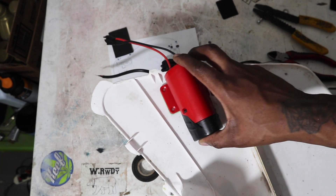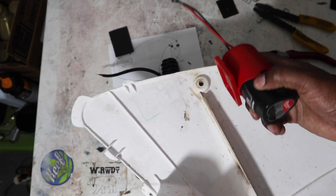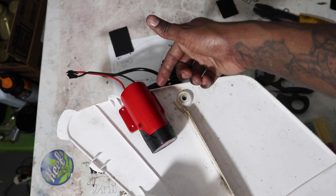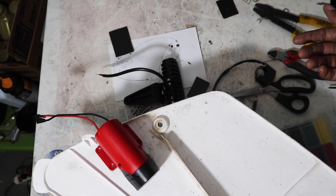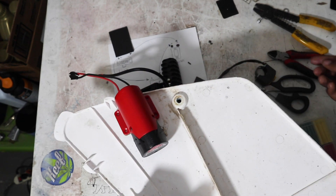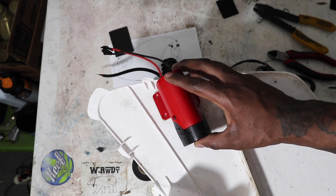After messing around with the bike a bit, I realized that under the seat attached to the bottom wouldn't work — there's just not enough clearance when taking the seat on and off. The best spot inside the airbox is the left side panel, like this. It sits flush and flat at the bottom of the panel on the left side of the air filter without touching the filter — there's still room. I'm going to velcro it in there; it kind of fits in a snug little pocket. I prefer to avoid drilling through the plastic, so I'll use velcro and snake the wiring through.